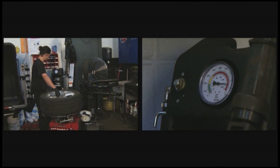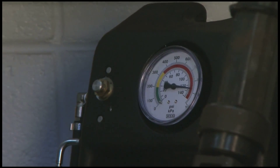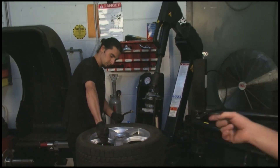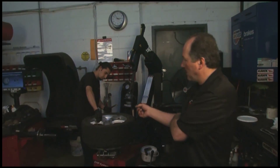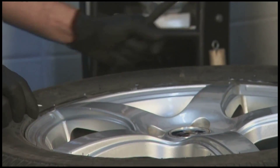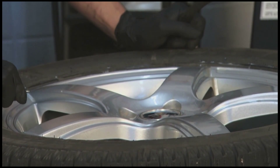What he'll do here is over-inflate the tire, then release the pressure so the tire seats in properly, and then inflate it again. The valve core tool he is using is made specifically for tire pressure monitor valves. There is actually a torque specification on that tool, and you'll see that when he puts it back in after you inflate the tire again, you'll actually hear it ratchet when it's tight.